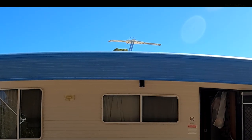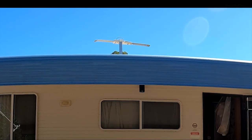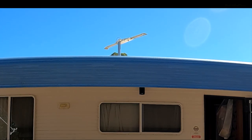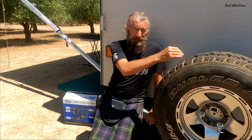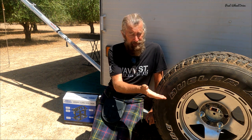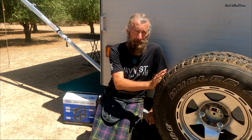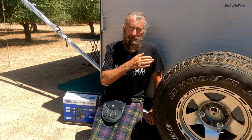The movement up and down and around of the TV aerial was discussed in part one of this series. Here I am at the back of the van. I've had a friend help me reinstall the wheel — the wheel is now centred in the van and also raised. The advantage of raising it is that if it sits too low, when doing off-roading the wheel could get caught and bust off and cause all sorts of dramas, so now it's hopefully a fair bit safer sitting up high. I also bought a jerry can holder which I'll put right here to carry the fuel — I can't put it on the other side because that would cover the number plate.